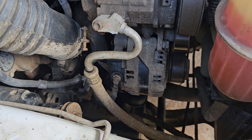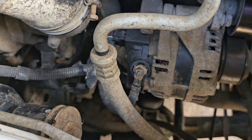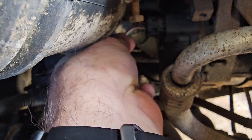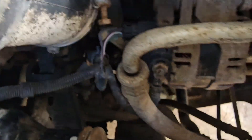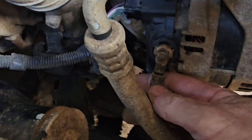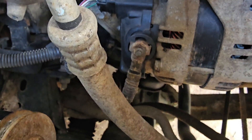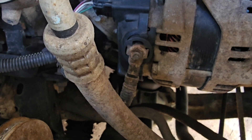I've removed the air cleaner box out of the way so that we can get some access to the alternator. A couple of the checks we want to do here: make sure that the wiring plug that plugs into the back to the regulator is all attached with no wires missing or hanging out, and also our main battery supply — the B-plus terminal on the alternator — is tight. Then we can carry out a couple of checks with our multimeter.